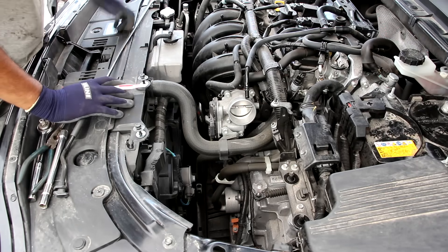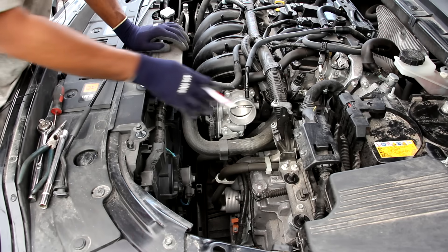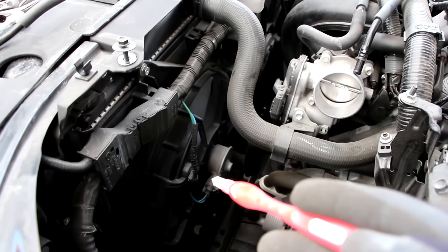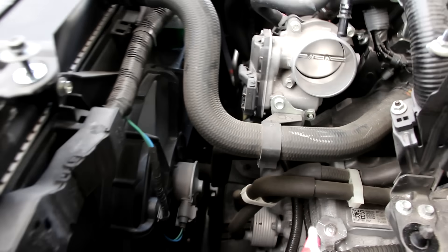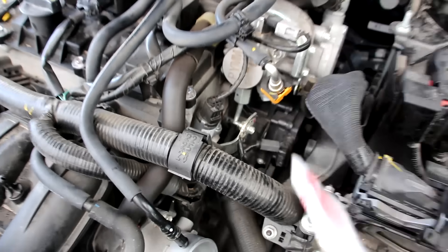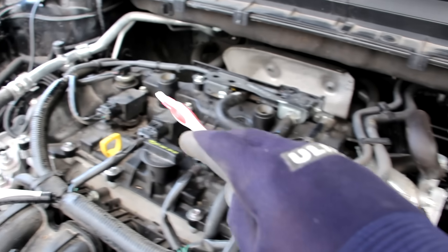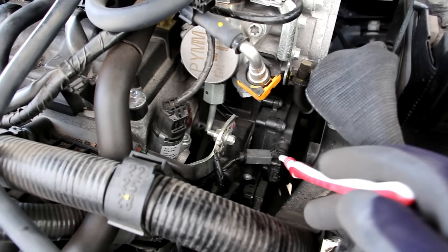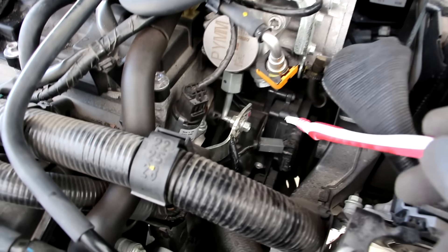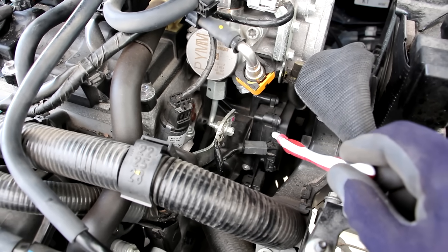Taking a look at the cooling system on the CX-5 — it starts here at the radiator cap with a single tank. We've also got this upper radiator hose that's going to bring hot coolant out of the engine. At the back of the radiator we have two electric radiator fans which do turn on even after you've turned off your car and locked it and walked away, just to help keep things cool. Looking further down below, we've got the lower radiator hose that runs alongside this upper radiator hose into this coolant junction. That coolant junction joins the upper and lower radiator hoses, the heater core hoses from the back of the engine, as well as a bypass tube from the water pump — and instead of having a thermostat inside it's actually an electronically controlled valve that controls the flow of coolant based on engine temperature. This housing is made of plastic and time will tell to see how long it's going to hold up.